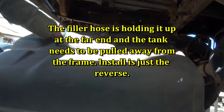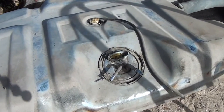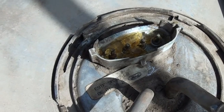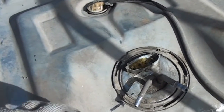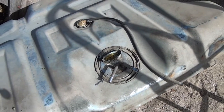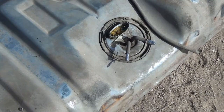That tank is free. I'm going to take it out of the truck, remove the old fuel pump, clean the tank, and put the new fuel pump back in. It says '90 Ford' on it, so this is an '87 that looks like three years later got replaced. I'm going to use a brass punch to try and loosen this after I lubricate it. There was probably maybe half a gallon of gas left in it, but you wouldn't call it gas - it was more like varnish.